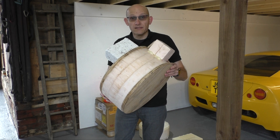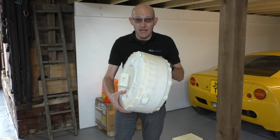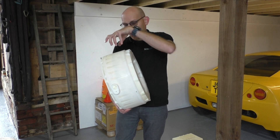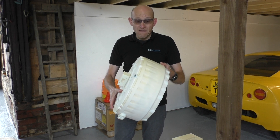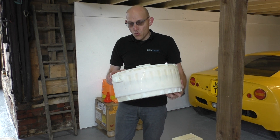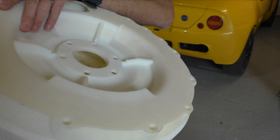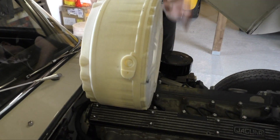So we did this — it's basically the same motor but as a fully representative 3D printed part. It also removes a lot of those pieces like the cooling parts coming out the top and other control pieces, and actually fits in the vehicle extremely well. The big concern we still had was only about 10 to 15mm across the diameter of the motor to play with to actually fit it in — clearly still a tight package even with a fully representative model.